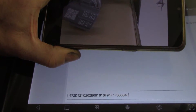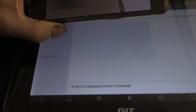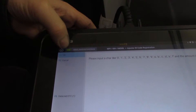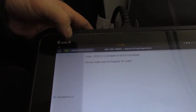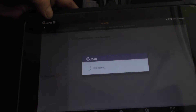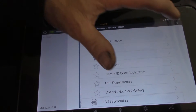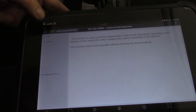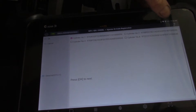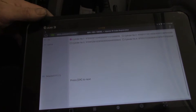Finally comparing that number 4 cylinder with the injector code and I'm happy that I've got it correct. We hit OK and we should be done on all of them. And we're back to our main screen — so they should all be coded correctly. They should end in just the last couple of digits with four zeros stuck in the middle, and yes they've all been changed.